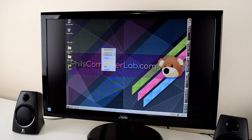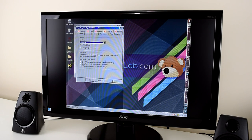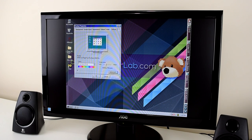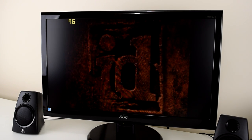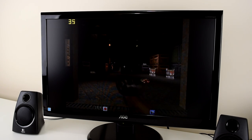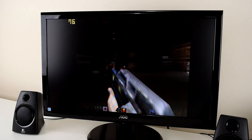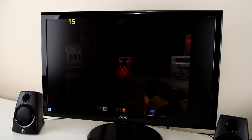and just see if we can actually change that setting, because the reason I always check this out is a lot of graphics cards, it doesn't really work and you have to use third-party utilities. So you click on OpenGL and you just tick this box, wait for vertical sync, apply, okay. And let's run it again and let's see if the change has been set. So it's around 75 here. So yeah, it looks like that the monitor setting has got a refresh rate of 75 Hertz at 640 by 480, so VSync is definitely engaged in this case.